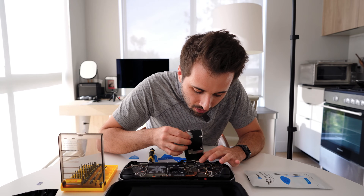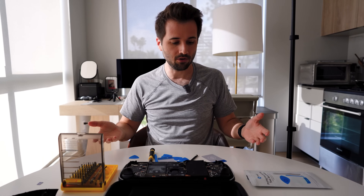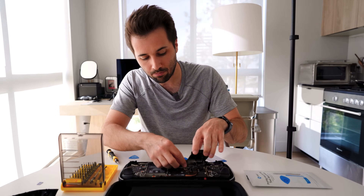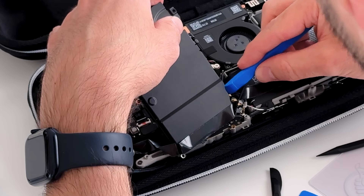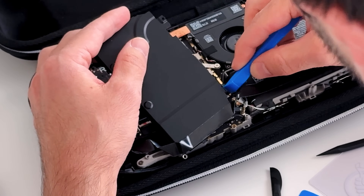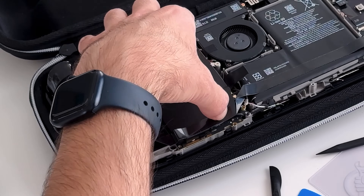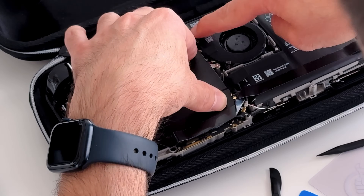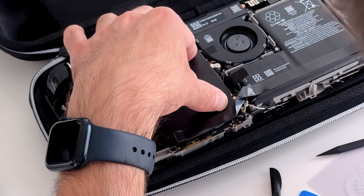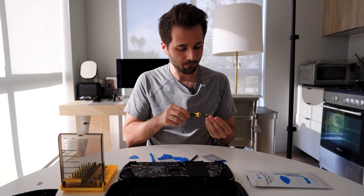I'm going to shimmy this heat shield just a little bit further up, and that's it — that's the hardest part. Now we're going to close everything back up. Before we do that, let's re-plug in our battery, which is very simple — just take it and push it here. Use your fingernail or the spudger on the corners. Give it a little push in; don't push the actual wire ever. You'll feel a nice snap when it's in. Now you'll see there are three screw holes for the shield, plus two others — those two you do not want to screw into; those are for attaching through the case screws at the end. Take the three screws and put them back in their locations.